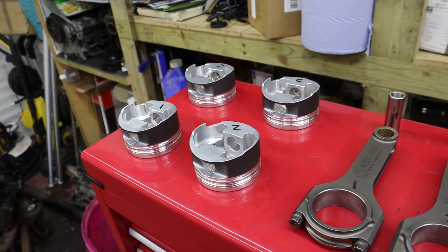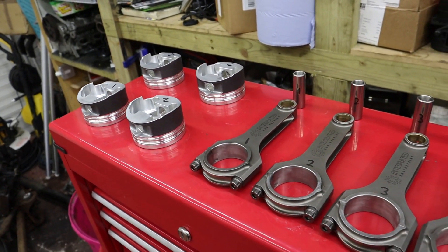The aim for this is so that my pistons, wrist pins, and rod combinations are all weight-matched cylinder to cylinder, so they will all be within a very small tolerance of each other. And that tolerance, for each component, I'm going to be setting at 0.1 of a gram. And that's pretty normal, to be honest — most engine builders, you'll tend to find that's what they aim for as well.